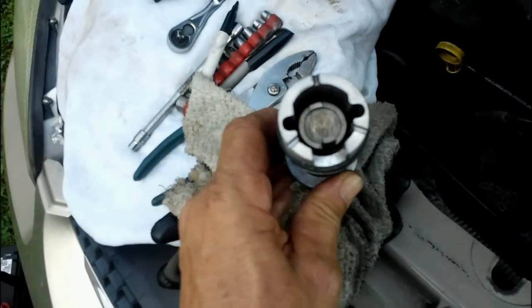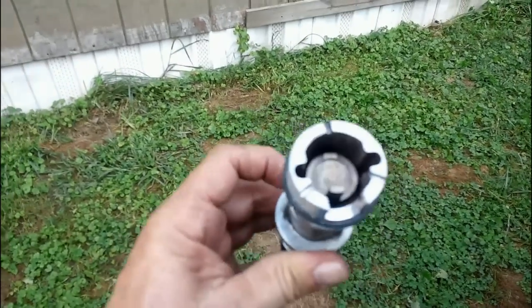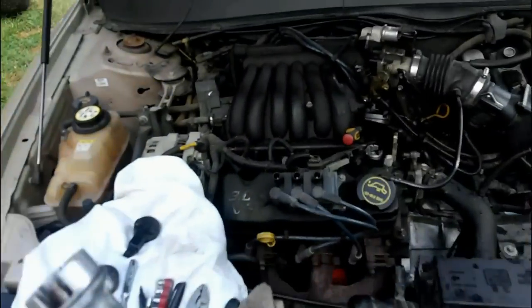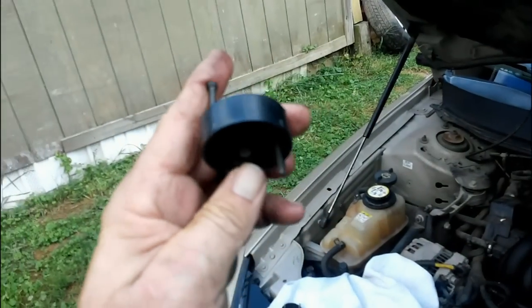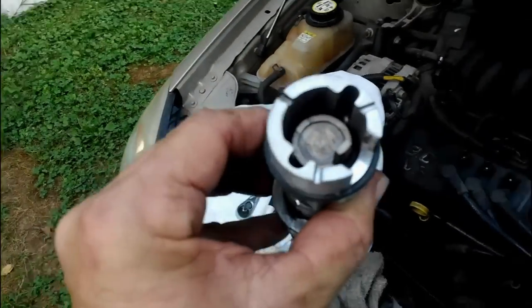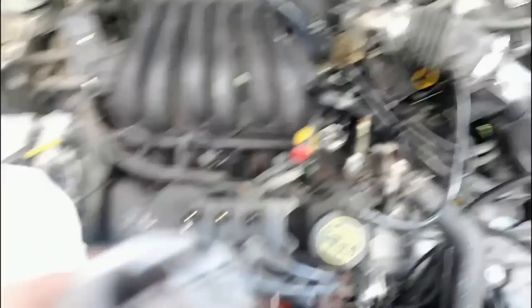Once you get it on there and you turn this top piece, you can adjust the marking where it's supposed to be on that cam. But when you get that on there and snug that bolt down on the bottom and start it — if it runs, it's going to be good. The thing about this is it's either going to run or it's not. The cam only has one position — you've got to get it right where it should be on that mark, and it'll run and you'll be okay. So make sure when you take that cam gear out, just mark it where that piece is, and put it back in.